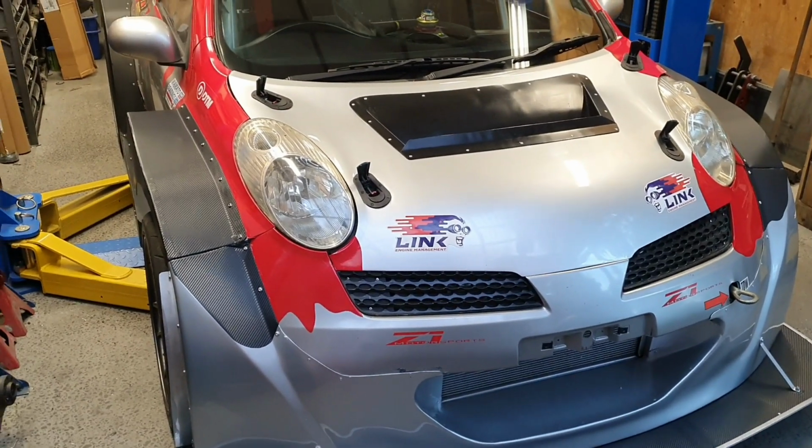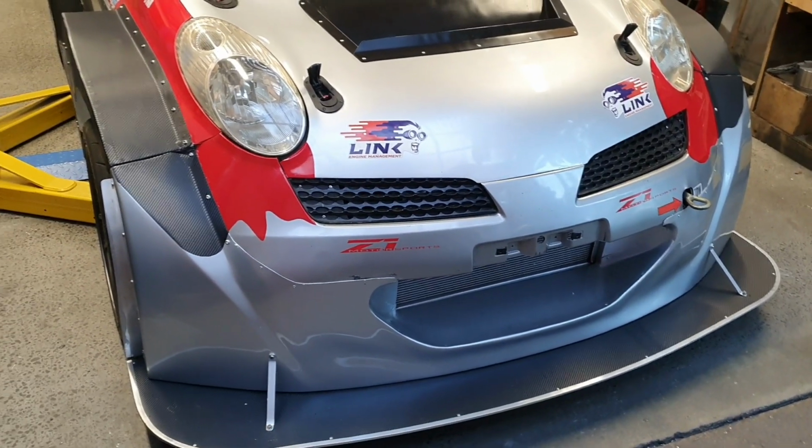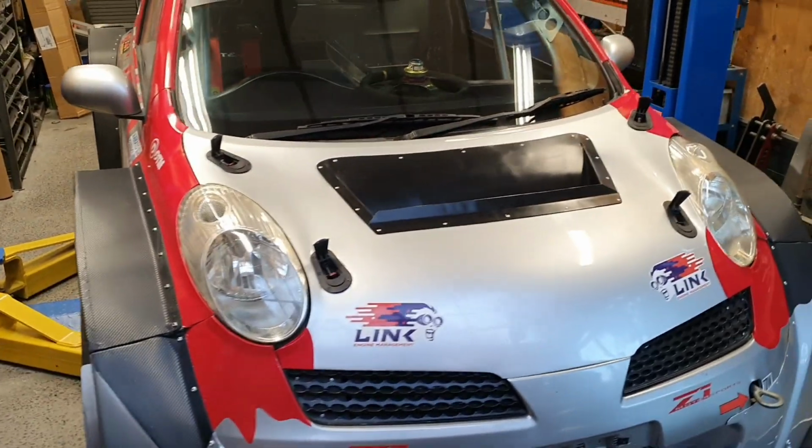It was running pretty good on the dyno as far as temperatures go. We definitely have resolved the head gasket situation, the bores wobbling around or whatever it was that was going on there. That's not an issue anymore. But of course, all those things are something that we just have to keep an eye on when we get out there using it, basically for the first time. Taupo's a reasonably high altitude track compared to all the other tracks in New Zealand, so the air density is not particularly great there, and the temperatures can be quite extreme one way or the other. Over the summer, it can be very, very hot at the track. So that's always a good test for the cooling system on any vehicle.